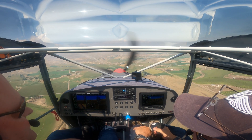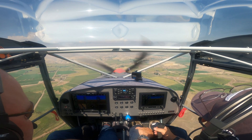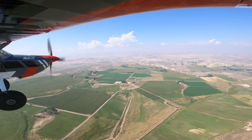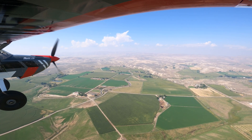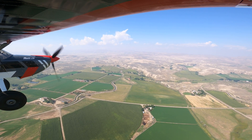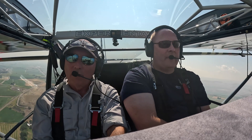This would be my exact configuration going up there. The higher you go, the faster you're going to go for a given power setting, and the 916 will maintain horsepower all the way up to 16,000 feet. So you're probably going to hit airframe redline if you just set the power and go to altitude — I've done that testing, accidentally. Airframe redline is 140 — miles per hour indicated. Wow.